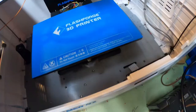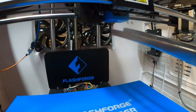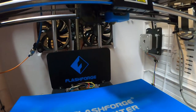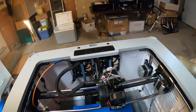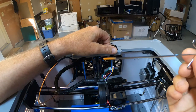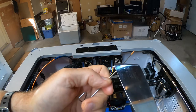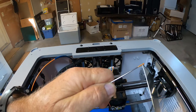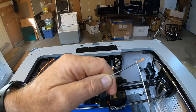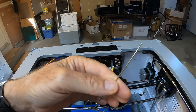Down below there's some filament we need to push out. Use tweezers to grab that film and put it away. When you pull the cleaning rod out after spinning it, some of the filament will stick to it. I usually use the spatula that came with the printer — it's kind of blunt but works perfectly. Clean it off almost before it completely solidifies, or it's hard to get off.